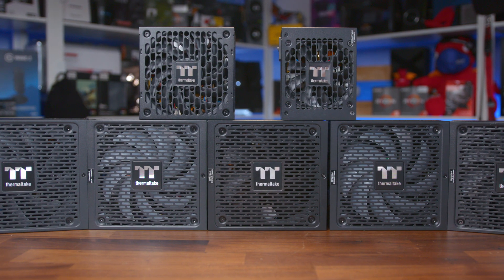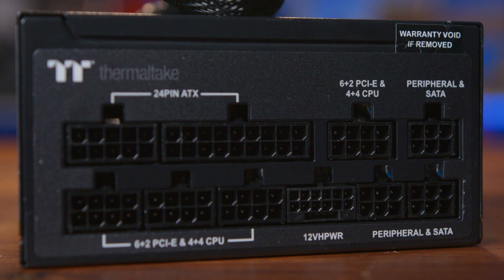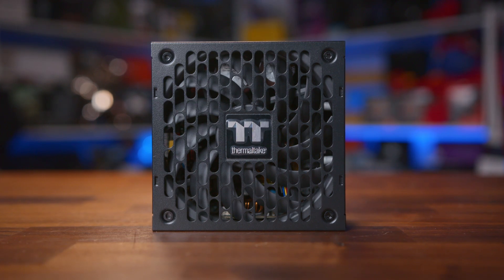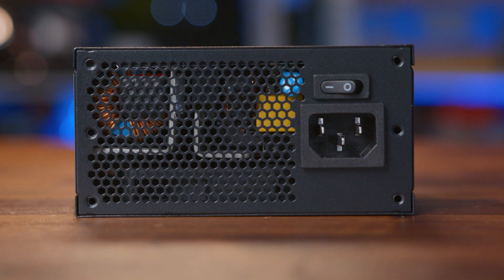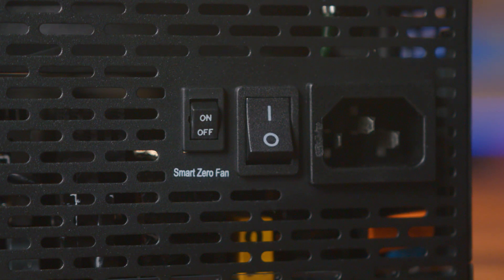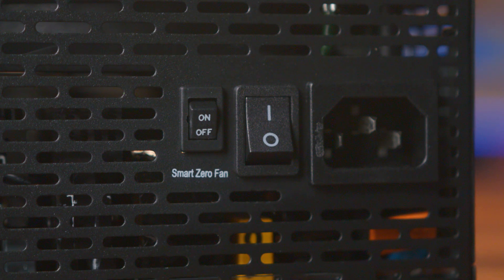While the average consumer won't see any real visible benefit, these new certified PSUs are able to be power cycled a minimum of 175,200 times — way overkill for even the most hardcore enthusiasts. Along with this, there are a ton of other benefits, including an alternative low power mode, or ALPM, which means faster system wake-up times, along with giving higher than 60% efficiency at 10 watts, or 2% of the PSU's maximum rated capacity. This also means the power supply won't need to work as hard at lower loads, so noise is kept to a minimum. Coupled with smart zero fan technology, like Thermaltake have on their complete ATX 3.0 PSU range, the fan won't even kick in until at least 30% load is reached, with a fan curve set in place that brings noise level up along with the load.